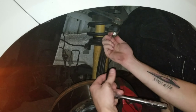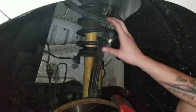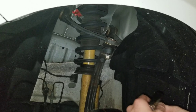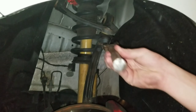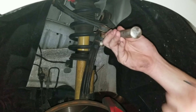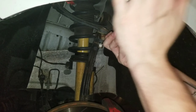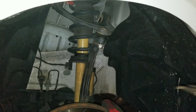What you want to do — because there's multiple ways you can try to get this to pop out — this is going to be the hardest part, getting this to pop out. We actually had to get a breaker bar. We actually used the end of a jack, and we used our pickle fork here. You're literally going to hit it in with a rubber mallet, then put the handle end of a jack and put all your weight on it and it should pop.